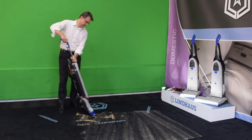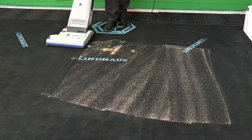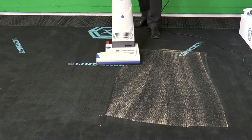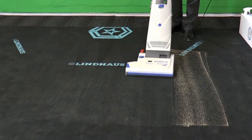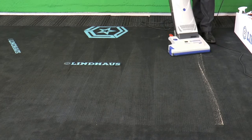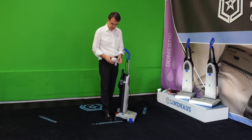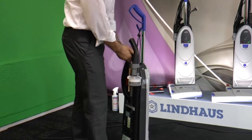Let's close it — the machine is ready for suction. Turn on. As you can see, thanks to the 5000 rpm brush roller, just one pass is enough to remove over 99% of all the dust. On the black carpet you can easily see the micro sponges — with a single pass the cleaning is almost perfect. Reattach the demo filter with a clean filter on the machine, and we are ready to vacuum the area that has been recently cleaned and sanitized.